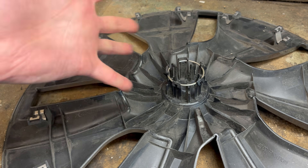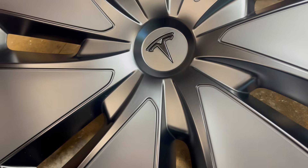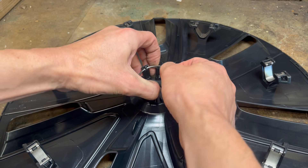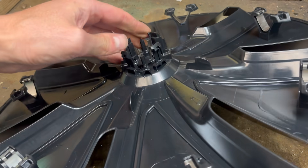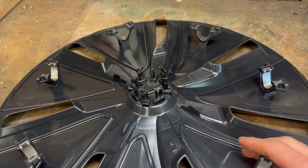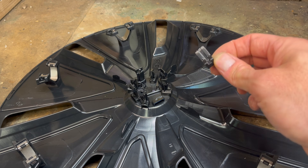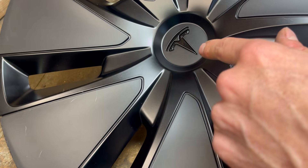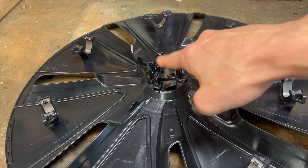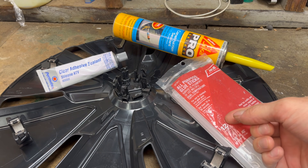If you have a Model Y and don't have that ability, check the description to see if somebody's already modeled this for you. On the 2024 Model 3, they've done away with the aluminum center cap — now it's just molded right into the hubcap. On the backside they do still have the original four-tab design and the spring can pop out just like before. These tabs are quite a bit different in how they're designed — I don't know if they're going to be stronger or weaker, but I figured we would just donate this one to science and see if we can break it off. Yeah, so these do just break off, so I imagine the 2024 refresh will have the same issue over time. Because there's no aluminum center cap, I don't know how we're going to hide a screw to secure any 3D-printed repair kit. You could probably just use some glue, so if you do end up 3D-printing a repair kit, please let me know in the comments and I'll link to it in the description.